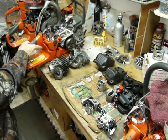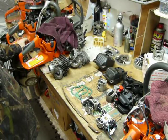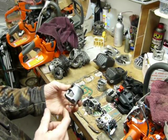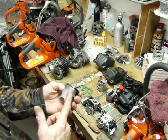We kind of talked about that before. We want to get back on the fresh air concept for a minute. We'll talk about this is the reason this used one came in. We have a problem with the piston meltdown. You can see we have seizure issues on the back, not where the charge is coming in, only where the fresh air is coming in.